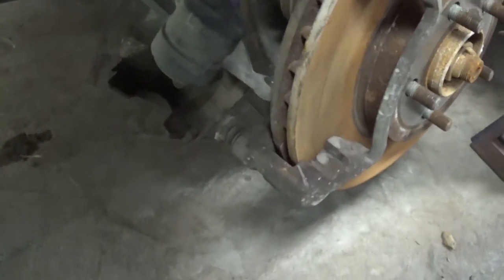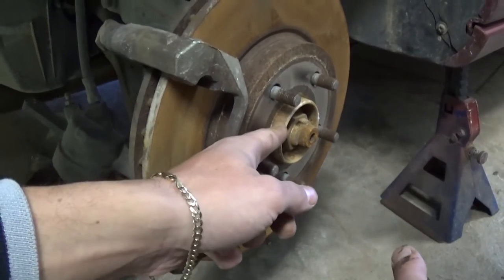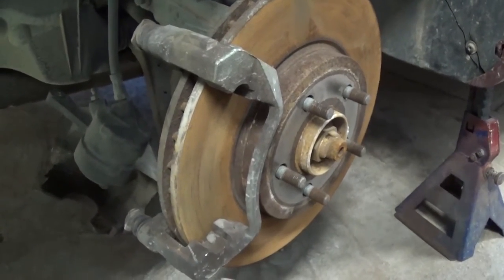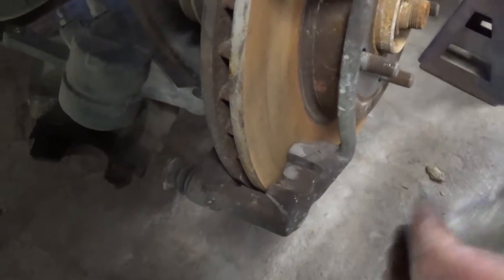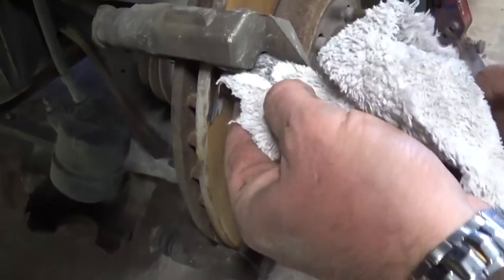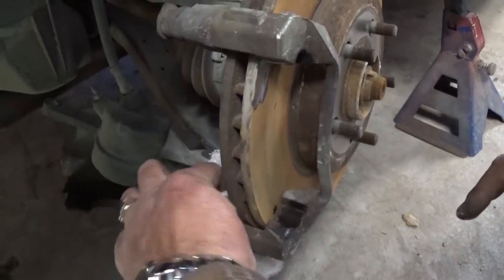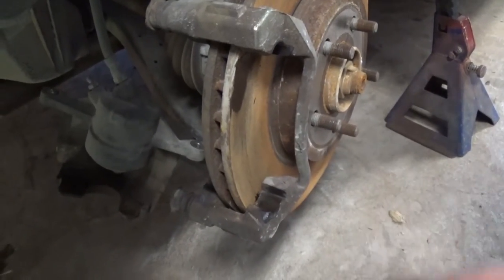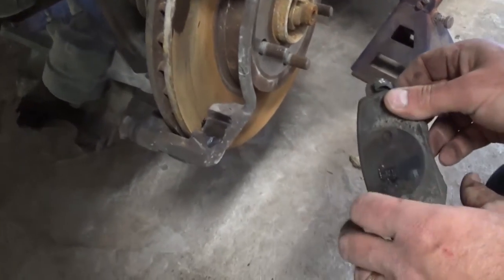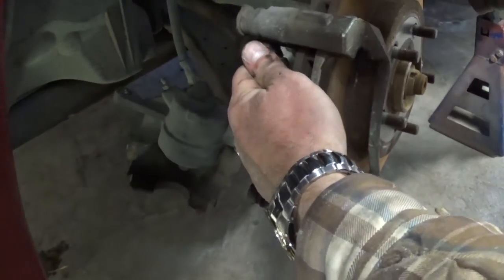You always need to make sure you inspect right here — you need to clean and apply a little bit of brake grease as well. If your wheel is stuck pretty bad, this area tends to form rust, so you need to clean here too. That's where the wheel contacts the hub. We're going to clean right here and apply a little bit of brake grease so the new pads will be sliding back and forth pretty easily. Because if they form rust there and aren't moving freely, your brakes might be holding and that's not a good thing.